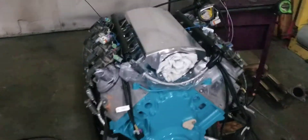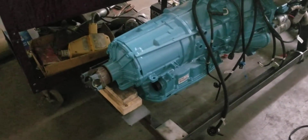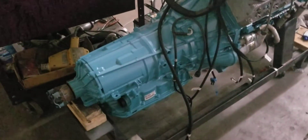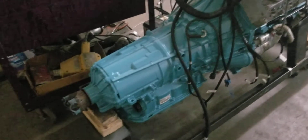This one's for a 67 GTO, just getting it ready to start. I had to read the TCM — this is a T43, a 6L80E out of a Camaro. It's an 09, so I've got to find the proper hardware number for the PCM to match the TCM.